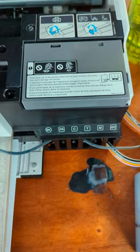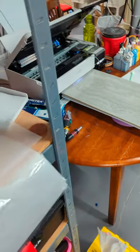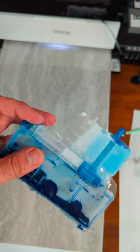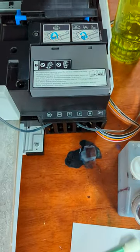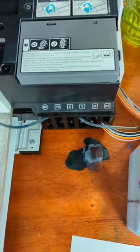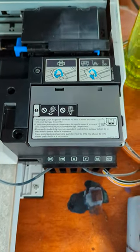Let me find an old one here. This is out of a different converted printer. The tubes connect to that — when you pull the ink line off of that, all you do is use the little splice connectors that come with the kit. Connect it in there, each one lined up with the respective hose that you're going to use. Mine — the print black, photo black, and the gray have my white lines in them, so I just connected that way. Pretty easy. You just have to take this apart, which does take a little bit of effort, but that's how I did mine.